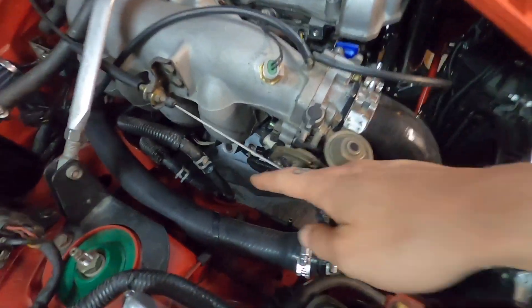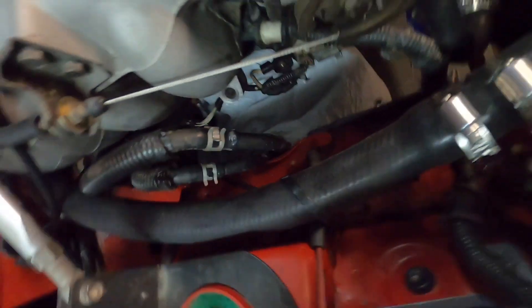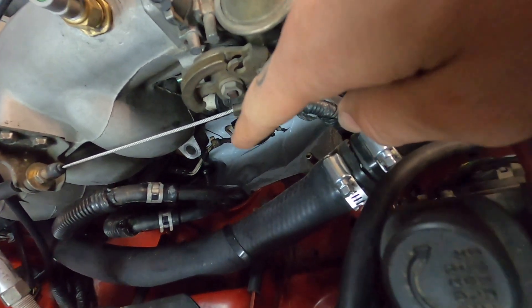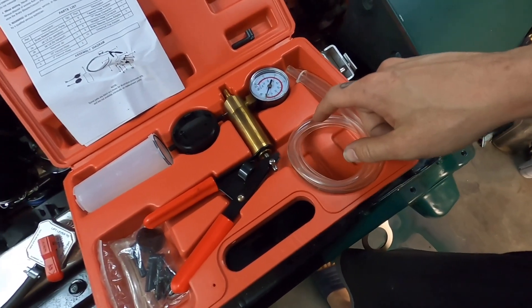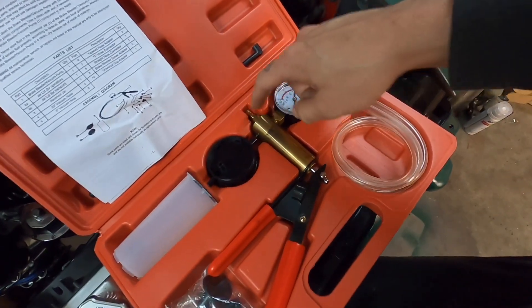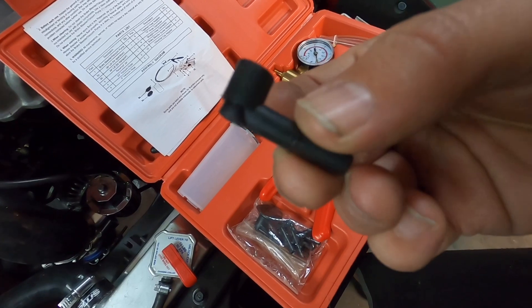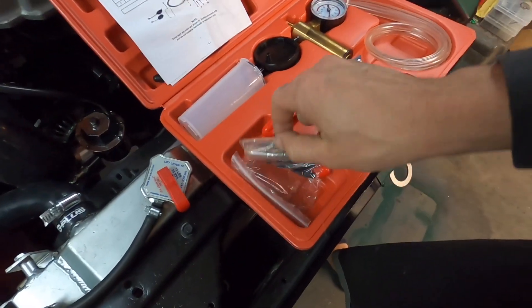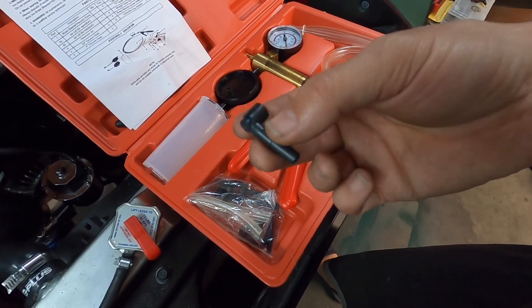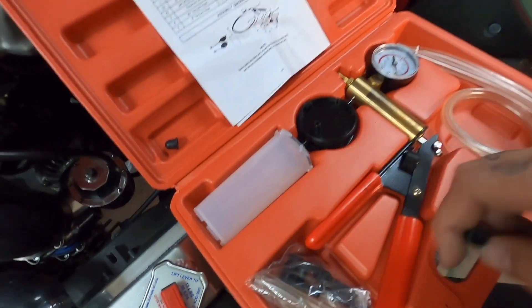After about an hour or so tinkering with different things, I decided I can tackle at least the clutch from up top here. I've got another plastic bag down here stuffed in place, and down there on the actual slave cylinder I have an eight millimeter on that little petcock. This unit is extremely easy to use — only one hose is going to transfer fluid, the other stays dry as it's just used for vacuum. We have our little nipple fitting that goes on one end, and this female piece goes on the actual slave cylinder.